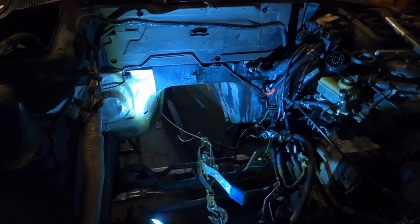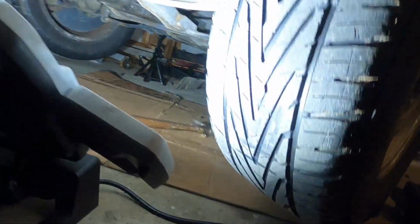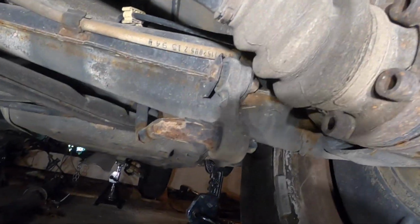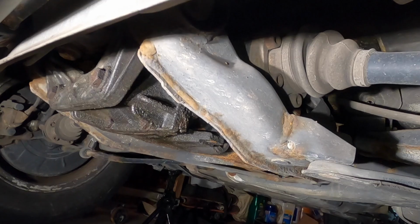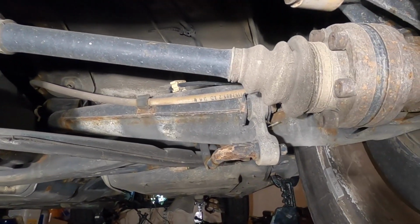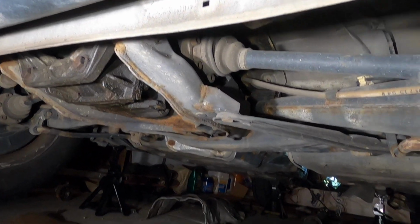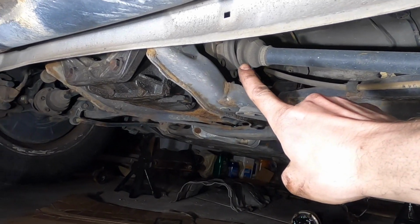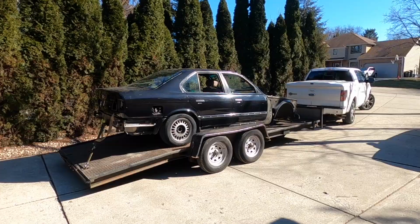So I mean, think about the force that this thing just did, pulling. Imagine what you would do without that. This is an ingenious way to pull drive shafts. For the axles, I don't think, you know, it's pretty intuitive. You get down here, you got Allens there, both sides. Do the inner ones on the diff first because your e-brake is the only thing now holding them in place. Then you got three diff mounts, one in the front and then two on each side, one on that side, one on this side, just like this. That's the only thing that holds that diff in.